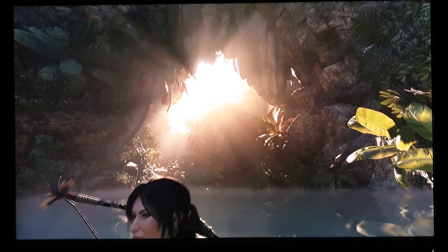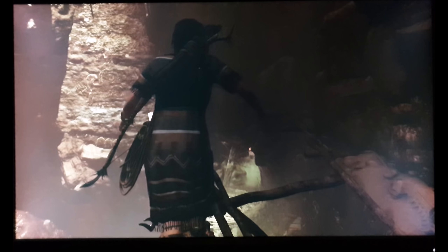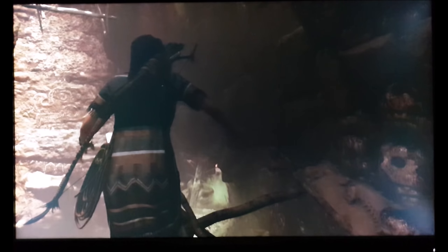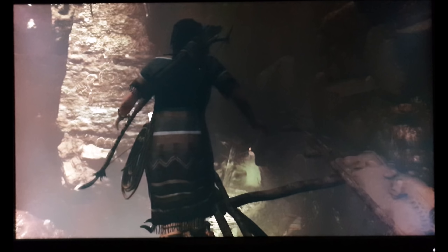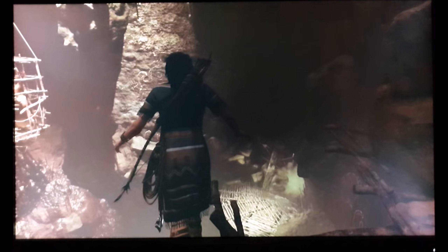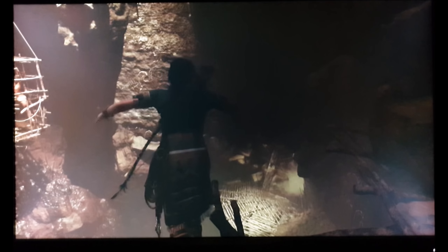The other aspect to consider is scenes where you've got predominantly dark content with some brighter elements mixed in. The backlight can't simply dim for those darker zones, because there are only 16 dimming zones for quite a big screen. Ideally you'd have per-pixel illumination, so the dark elements looked very deep and the brighter elements were illuminated appropriately. Unfortunately with only 16 dimming zones you don't get that level of precision, and what actually happens is the very dark elements look kind of flooded — significantly brighter than they should. As I've included in the written review with contrast measurements, the black level under HDR is considerably higher than under my test settings using a much lower luminance.